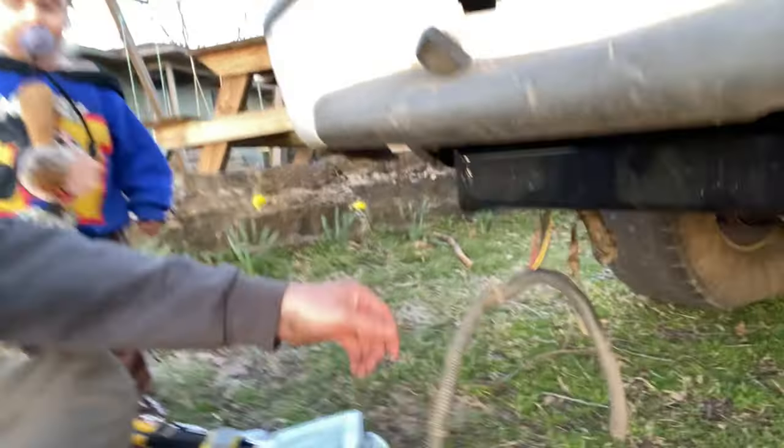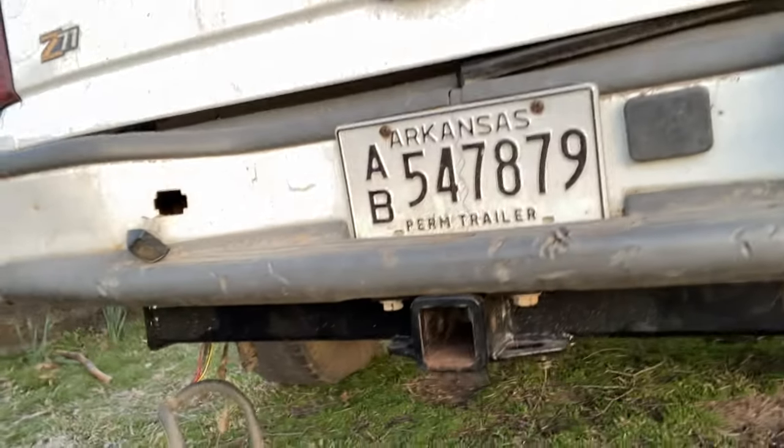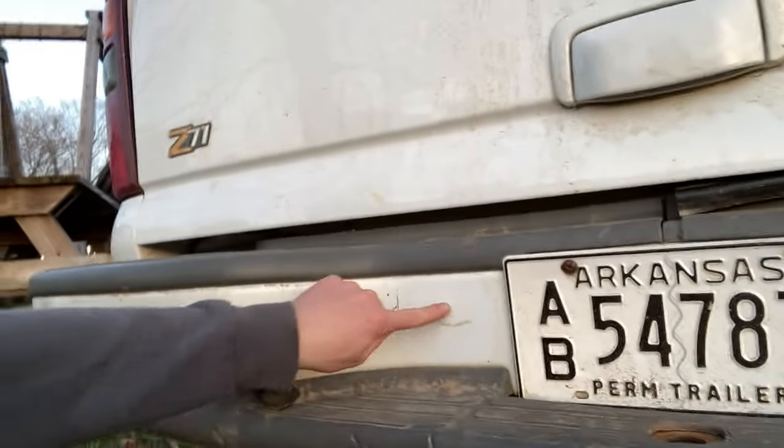Time to tackle some wiring. I need to redo this splice — it got a little torn up and it was hastily done to begin with. I've got some better connectors now — some heat shrink butt splices — so this is going to work better and seal everything up better. I also need to redo the trailer plug, and I've got one of these that I'm going to put up here in the bumper by drilling a hole, so it's not hanging down to get broken off like the last one was. That's what I've done on the Suburban — it's a much better location. I'll make this short because wiring is boring. I hate wiring. I do low voltage stuff for a living but I hate vehicle wiring and wiring harnesses. It's just not any fun, but it's got to be done right.